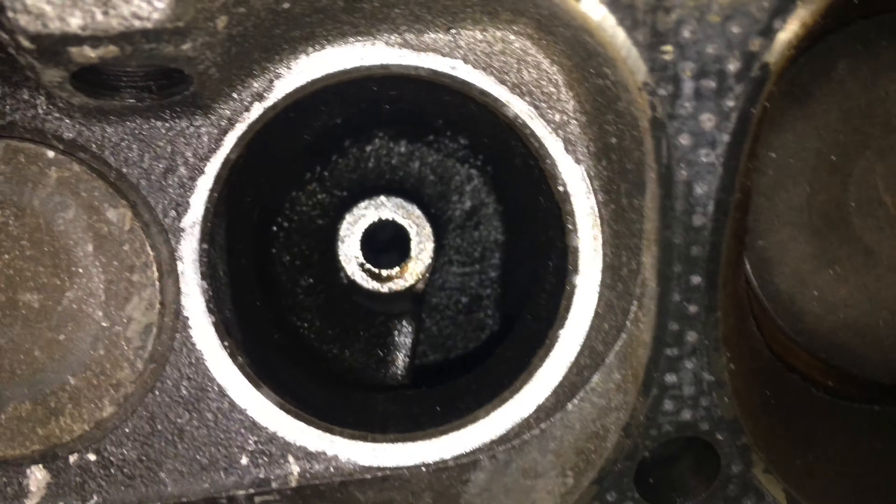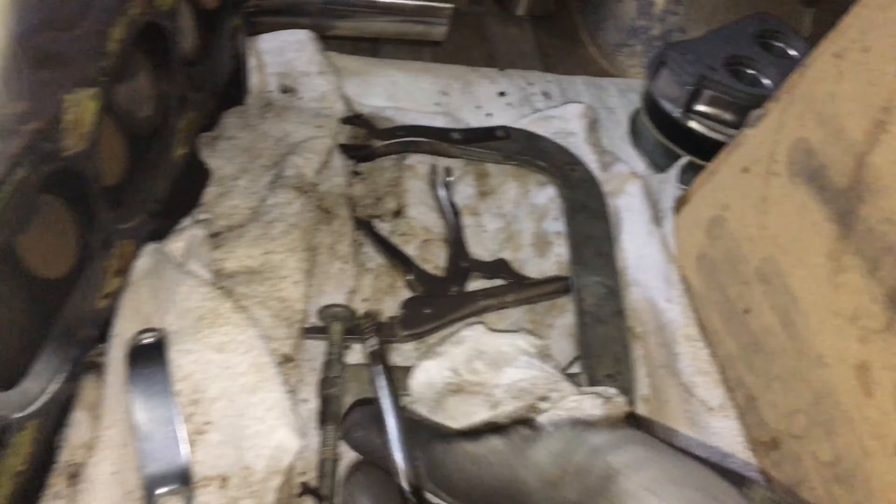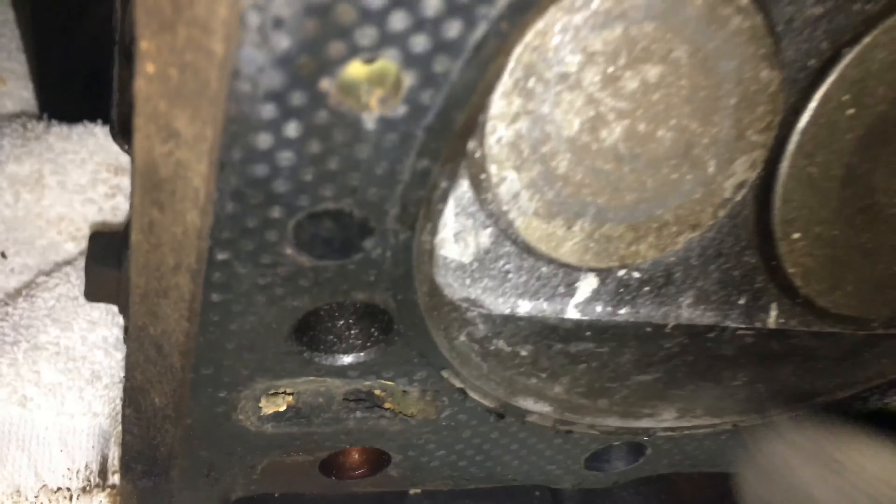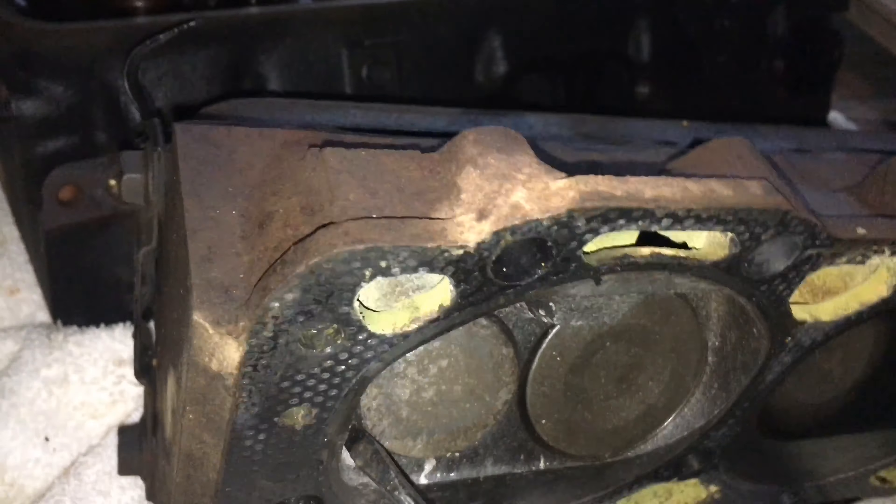There's a lot of carbon in there and a lot of oil. So that valve stem seal was bad. There's a lot of carbon and oil in there but the seat looks okay. We could always just throw a set of valve stem seals on it, use a lapper, clean them junks up. That's more than enough to run a few more times. We got a little welded aluminum in there we can clean off. There we go — souvenir. It's definitely salvageable.